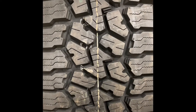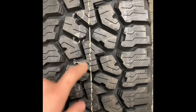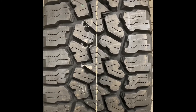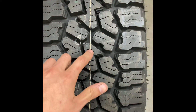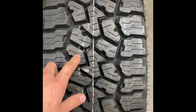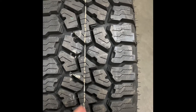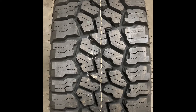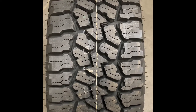If we dig a little bit deeper into the center of the tire, it does have a continuous center rib right down the middle, and it has kind of a Z-like shape going throughout the center. Looking closer at the block, it does have two-dimensional sipes on the block itself, and on the outside block as well. With the blocks being so close together in the center, this is what largely determines road noise — the closer together they are, the smoother and more comfortable the ride.